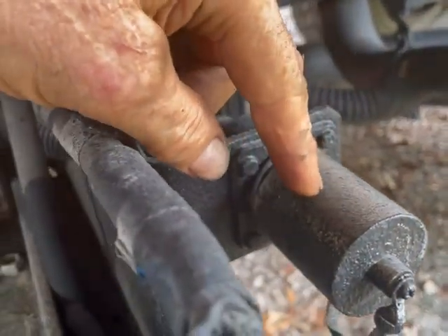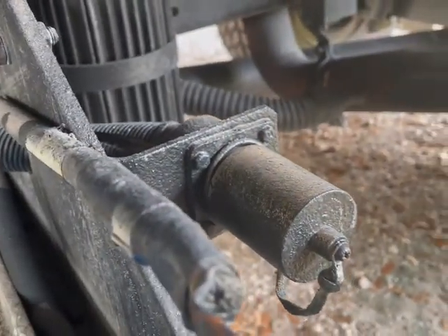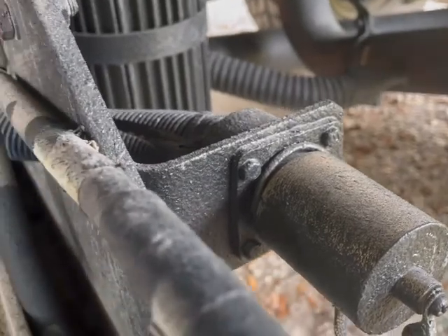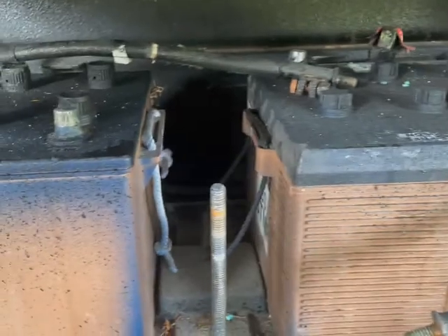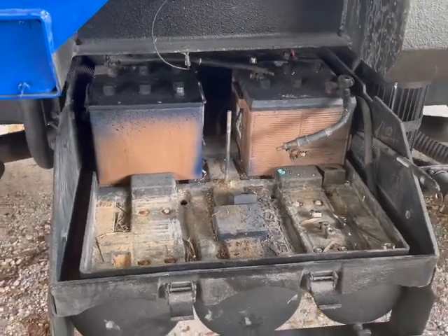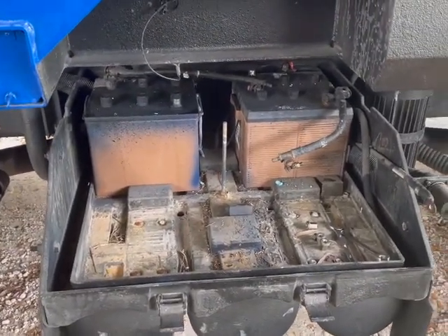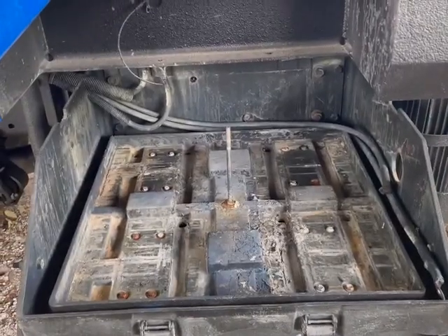Now this out here — when you go to the Group 31 connections, you can either leave it or not. If you want authenticity, you would leave it because that is your NATO connection for the battery charger. You would be wise to check which is your 12-volt connection and which is your 24-volt before you take them apart, and mark them accordingly.